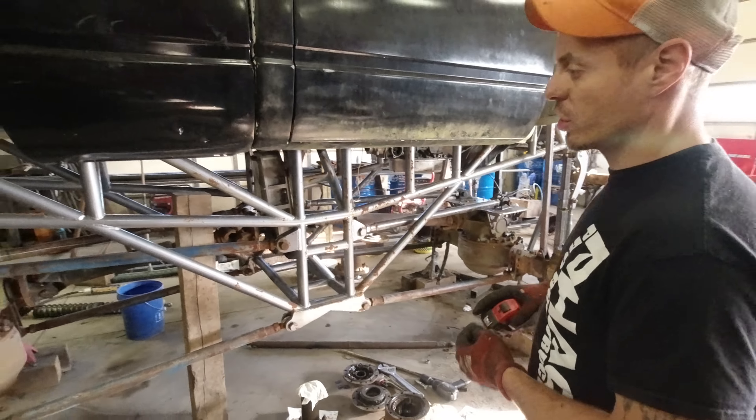Take the time to fix the subframe - just bring it down. Right there tells me how far my subframe needs to be. If 36 is where my eyelet's going to be, 36 minus 3 equals 33 inches - that's where my subframe would hit. On Matt's truck, let's see what this one is - that's 34 inches. So it's pretty damn close from the top of the pipe to the subframe.